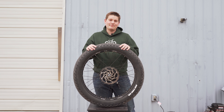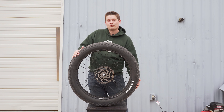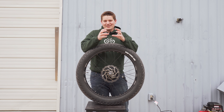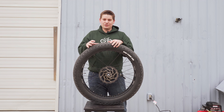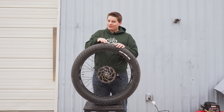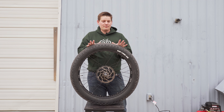I said faster because a tubeless setup has less rolling resistance. It may be a little odd to think about, but as the tire rolls and rotates, at the very bottom of the tire it's going to compress with every rotation. At some point the tire and the tube inside is always being compressed down and then expanding back out. There's a certain amount of friction when that happens. When you remove the tube, you actually remove a bunch of that friction.